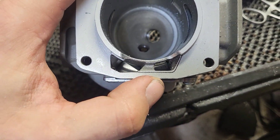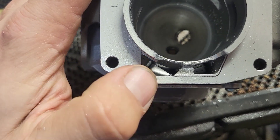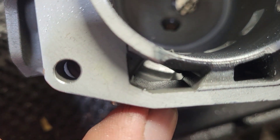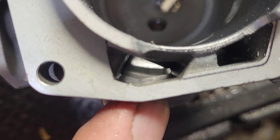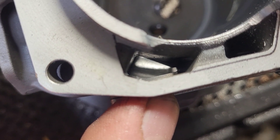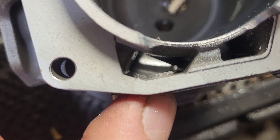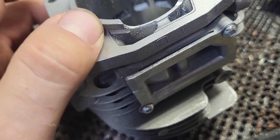I'm going to start out by gasket matching everything. Taper that in a little bit. There's a step in your primary on the back — you can kind of see it there. I'm going to try to blend that in to the transfer cap, and I don't think that's changing. That's essentially a bottleneck, but if you swoop that back toward the cap, there's a hump in there that helps direct flow as well. So I don't think it would hurt going from here to a bigger hole. And then I'm going to relieve the skirts out all the way to the edge as well.